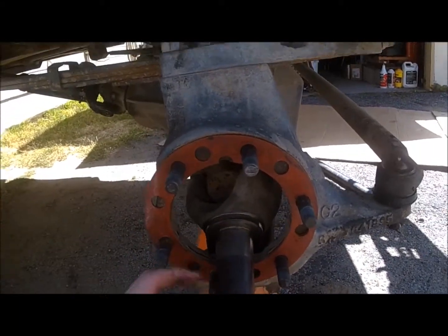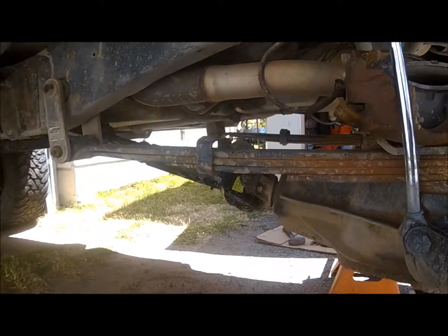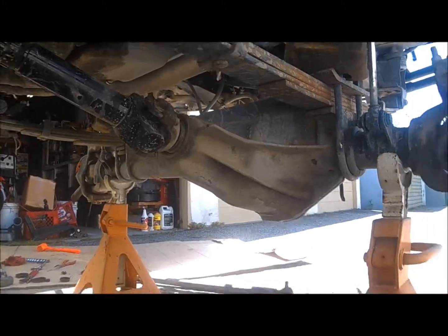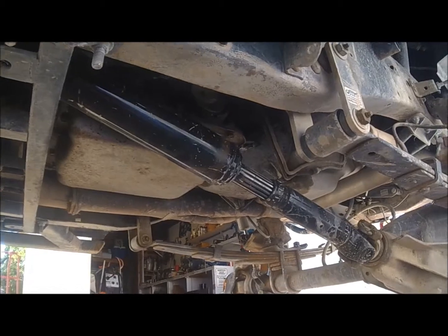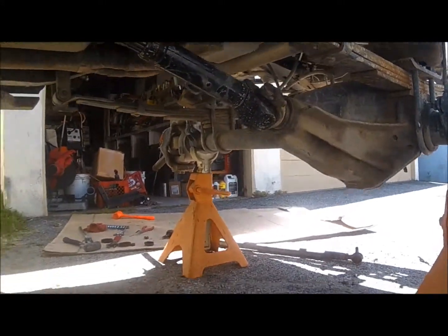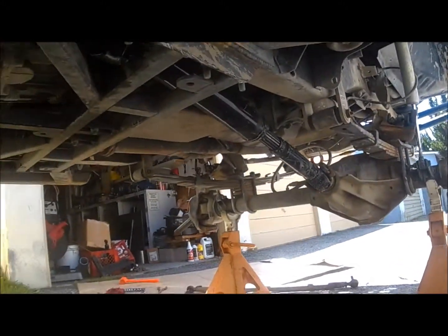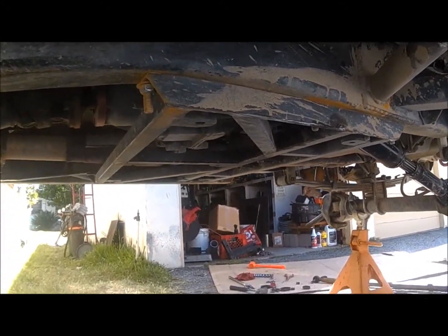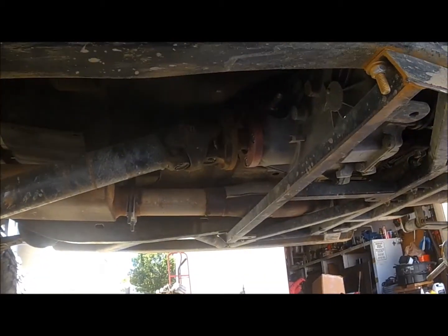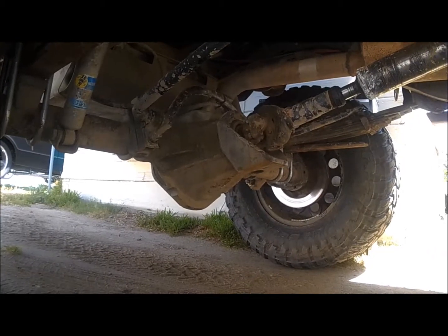We'll go around to the other side — same thing: super Yukon axles, the springless WFO arm. You can see the driveshaft they just got put on. The drag shaft I was using ended up being a little too short one day and popped off, so I decided to upgrade to a longer slip spline — it's about a 9-inch slip or something. Going down underneath, you can see I've got a pretty flat setup. I did a transfer case clock and a CV with a SYE slip yoke eliminator to my Dana 14-bolt.